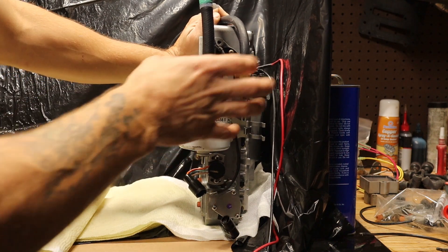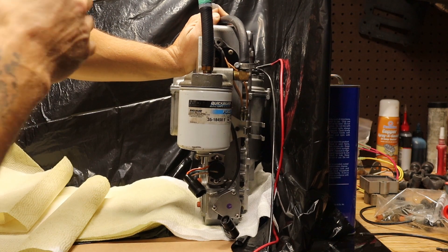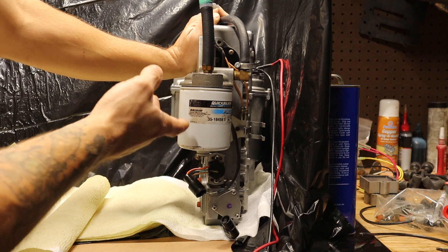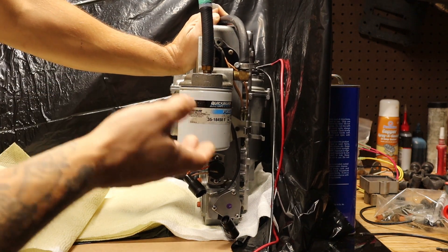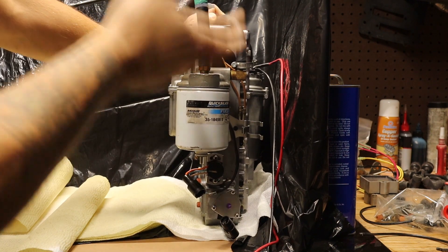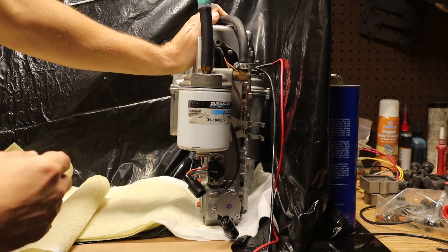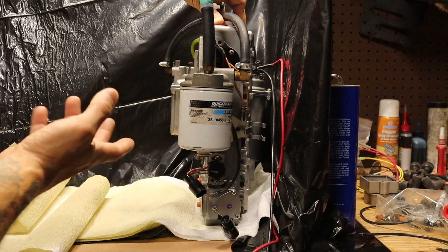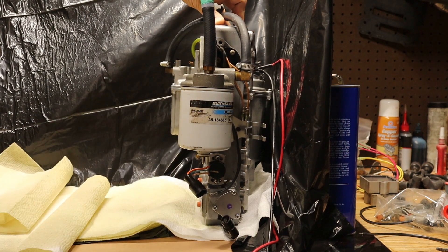This is good insurance — if you already have EFI on your motor and you're going to replace reeds or do whatever in your maintenance protocols, pull this thing off and fire it. I drain all the fuel, or fill it up with mineral spirits. It's safe for the injectors, and mineral spirits have a mild solvent cleaning property as well as a little bit of lubrication. It's just an all-around good mild solvent to use, plus when you atomize it you don't have to risk blowing up your garage.